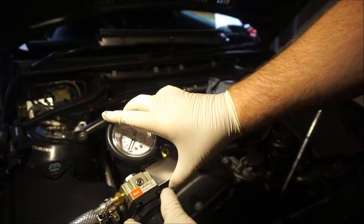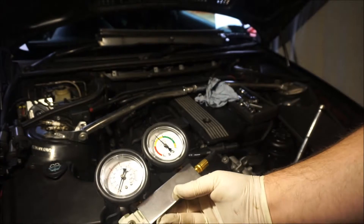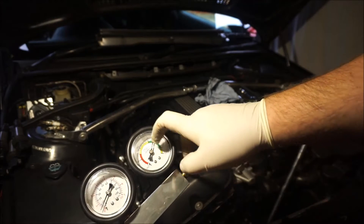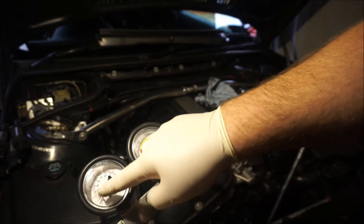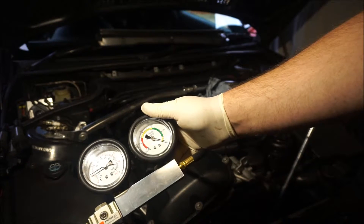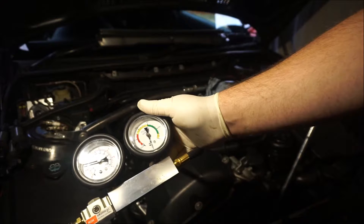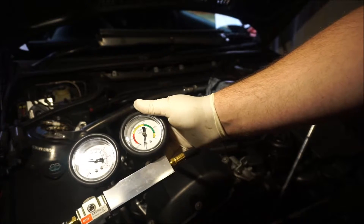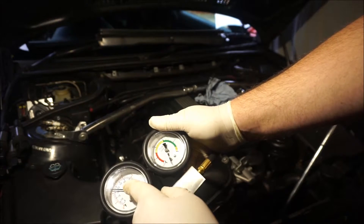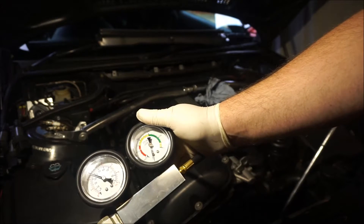So the compressor is on. What you do first is pull to release all the pressure and then apply the pressure. So here we got no leak and here we got a hundred percent leak reading. I'm applying pressure and the needle goes - cylinder number one is at top dead center. The engine was rebuilt and piston rings were replaced due to oil burning, which is common on the M54. We're getting nearly 40 psi and the needle actually goes to minus.